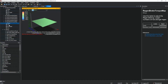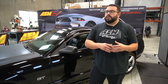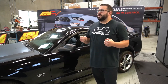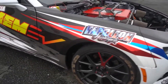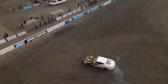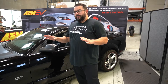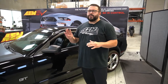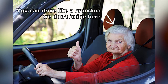We can tune and manipulate the regenerative torque, which is our braking torque. If you've driven a Tesla, you might find that the regenerative braking is quite aggressive — it tries to put as much power back into the batteries but may not be well suited for good vehicle control or stability or performance. All of that is tunable in the VCU. Your motoring torque, your regenerative torque, all controlled by your pedal. There are four different pedal maps and you can make it wildly aggressive or as calm as something your grandma might like driving.